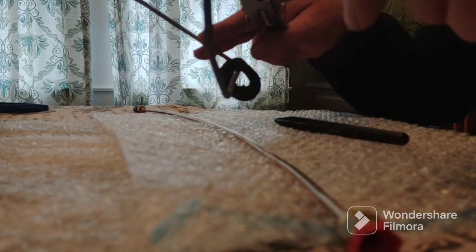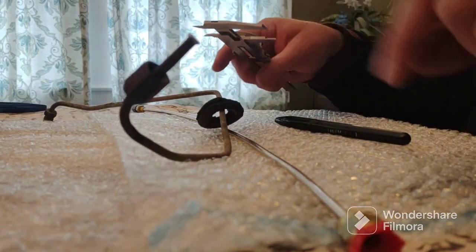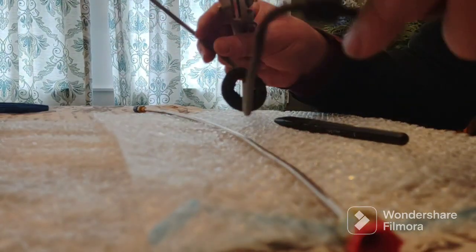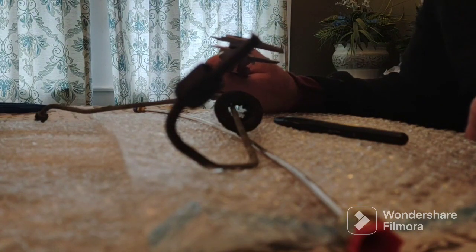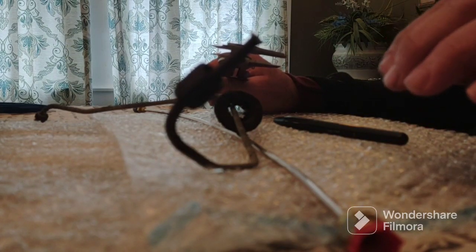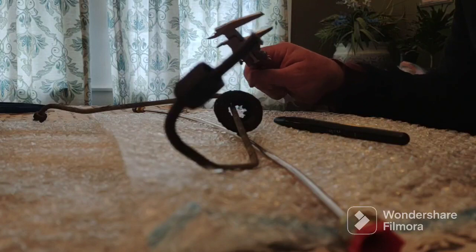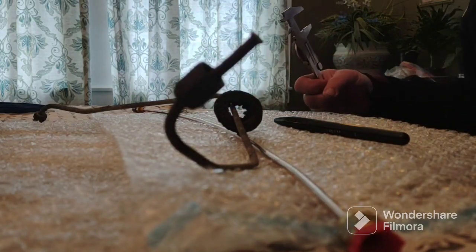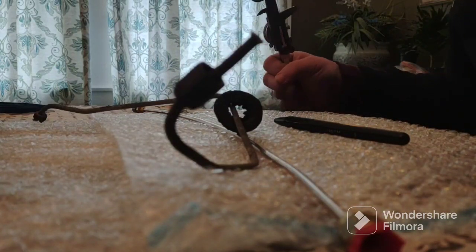That's assuming the new and old lines are the same length. I could try to bend the old line straight, but it might break because it's steel. If you have a very long brake line with a bunch of right-angle bends and you can pull the old brake line out while it's still in its formed condition, then you can fully form the new line off the car and bring it to the car and put it on. Some of them are tricky.